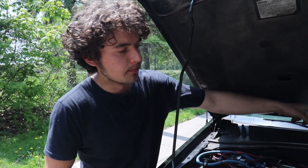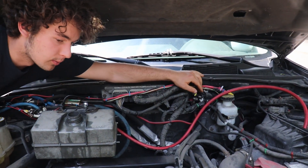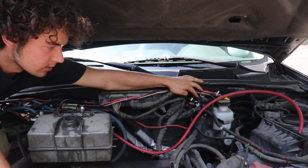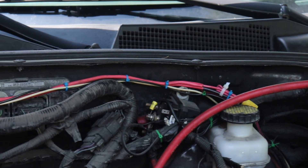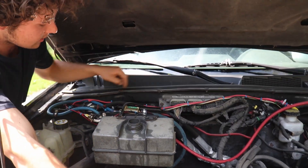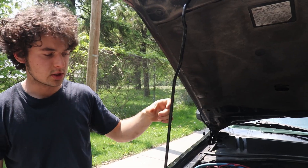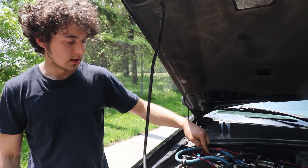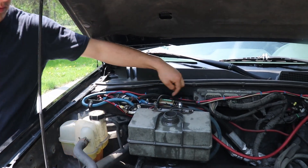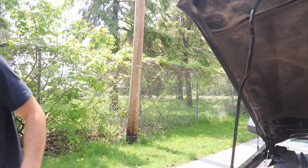From there, I took a wire going through this 12-volt solenoid, which turns on and off the rest of my electrical system. When I turn the key on, this solenoid turns on. From this solenoid I connect multiple things — like the lights in front, a CB radio inside, and other accessories. I also made another lead going to a second solenoid that is controlled by the hydrogen switch. When I turn the hydrogen switch on, 12 volts comes into this wire, the solenoid turns on, and power flows from one side of the solenoid to the other and into the HHO generator. That's how I can tell if it's working or not.